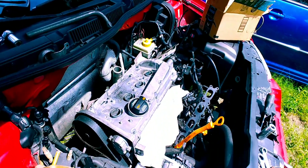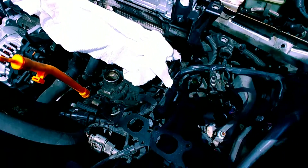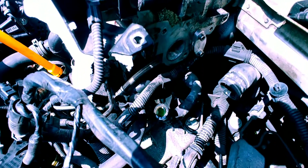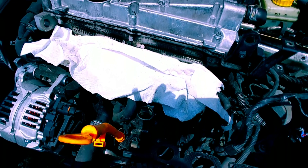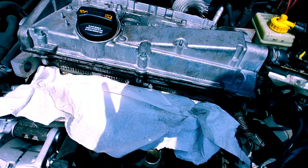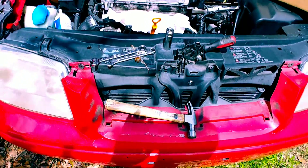So that's what I'm working on today. It's coming along. I painted the other valve cover and the intake manifold, plus some other stuff. I got the gasket for the coolant flanges and I'm going to be hooking the cooling system back up — the flange right there that holds the sensor. I'll be putting a different valve cover on it and cleaning things up. Then once I do that, I'm going to set the exhaust manifold on there — the T3 turbo manifold for the new one. I still need to get the bumper off and do the intercooler.